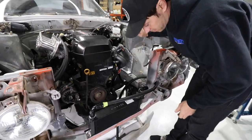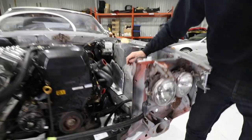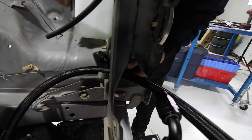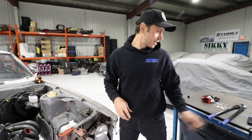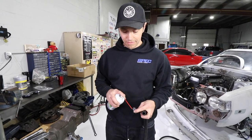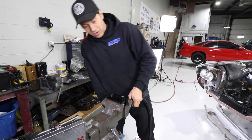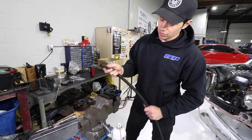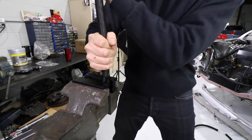Just trying to figure out how to route these lines. It's looking like our pass-through idea here is working out very nicely — better than I expected. Every hole was designed for this. It will actually pass the dash-10 fitting through it — literally press fit, but it does go through. That means we can get on to building our lines. I haven't done fittings like this in a while, but if memory serves me correct, lube is always the key.